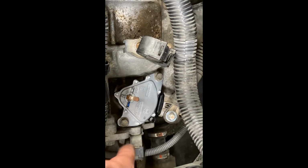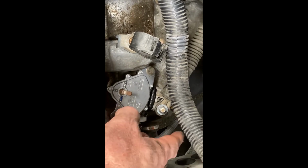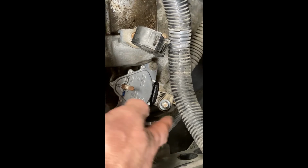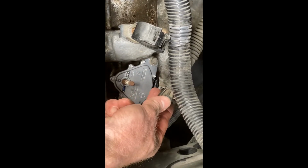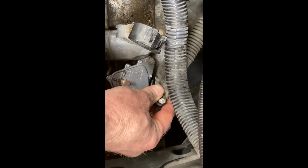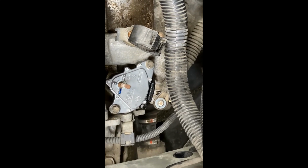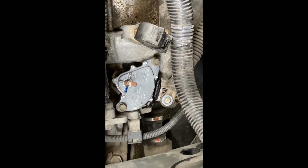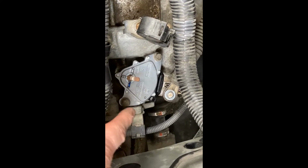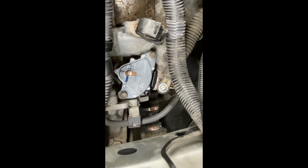And I also bumped the little gear shifting arm while I was doing that and knocked the car into drive, which is no big deal because I caught it and put it back in neutral, which is just as simple as this. Like right now it's in neutral, now it's in drive because I pushed it. Now it's back in neutral. So if you happen to accidentally bump that, make sure, double check you're back in neutral before you go and put your control arm on, which now we're going to do. I don't know if I mentioned it, but these 2 bolts here and the other side there, 10mm.